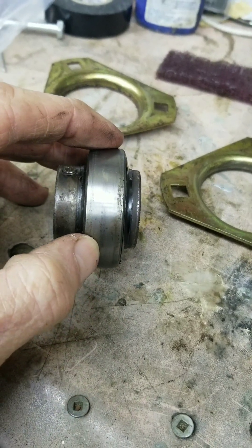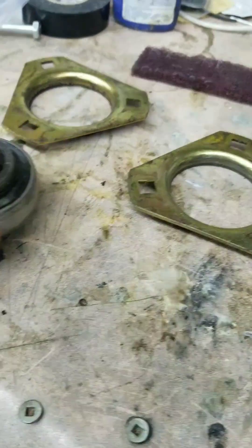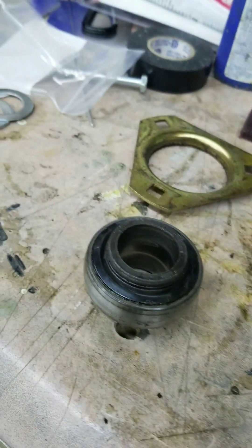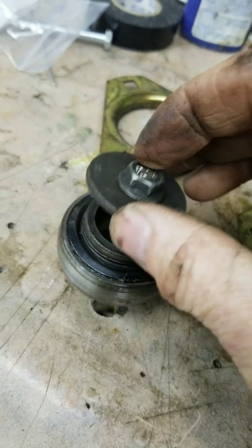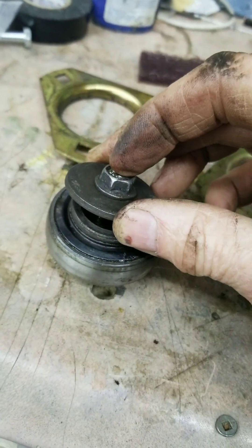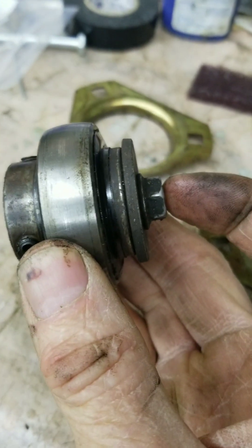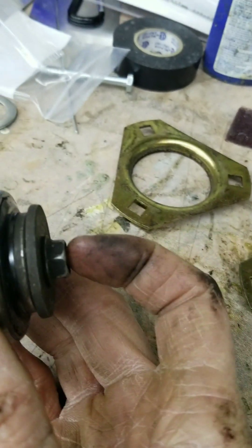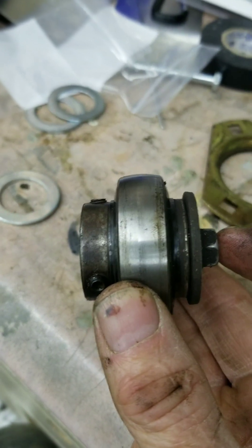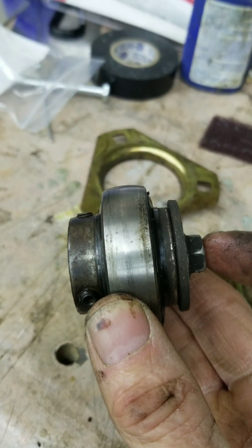That's what differentiates this from other bearings I can find, and it's necessary because the back collar has a bolt that goes through here. It's a bolt and a big washer, and that bolts into the end of your drive axle. This spacing is critical because if the spacing wasn't there, the axle would move further in this direction into the transmission and probably damage the transmission. So the spacing is critical and has to be kept.